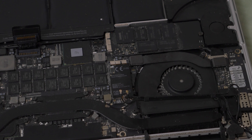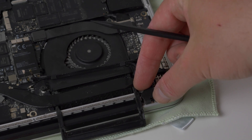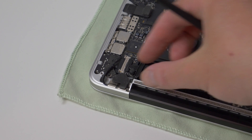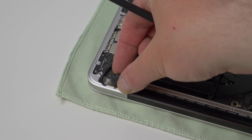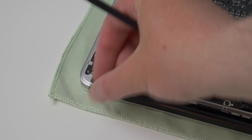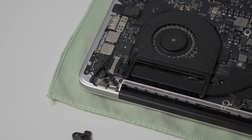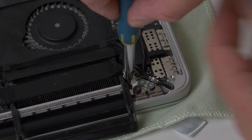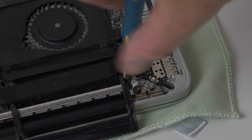At this point, we can remove the triangular rubber hinge screw covers from either side to expose the six hinge screws. These are stuck to the screws with a small piece of double-sided tape. Right next to the hinge screws is the metal hinge cover, which is held in place by a single Torx T5 screw. Remove these from both sides.